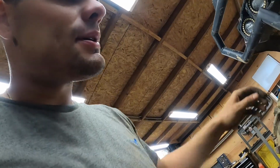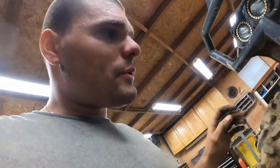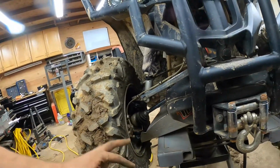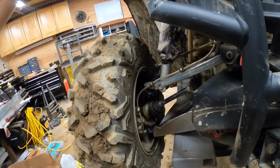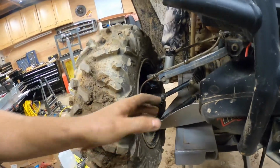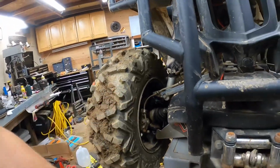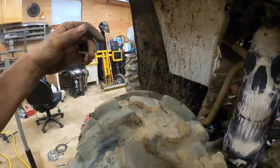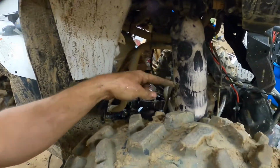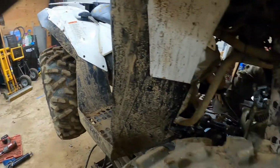Alright, YouTube, so we're back. As I was saying, there were a few things I noticed which I was not happy about. Besides the brakes, there were a few bolts, specifically with the control arms. I think 3 out of the 4. Excuse me, I'm still pretty sick, so it's a little hard for me to breathe. So 3 out of the 4 were loose and didn't have cotter pins. So all of them have cotter pins now. I also took the time to grease everything that had a greasable fitting, including the drive shafts, everything.